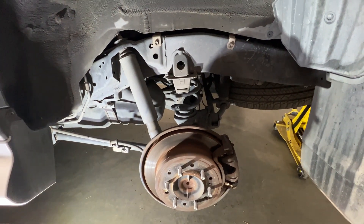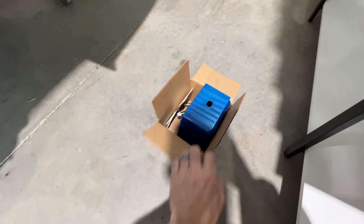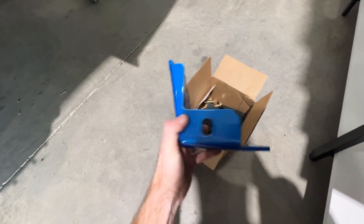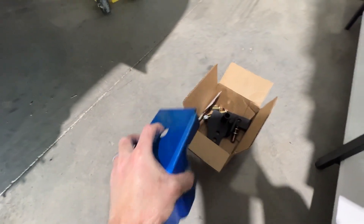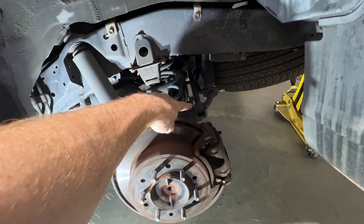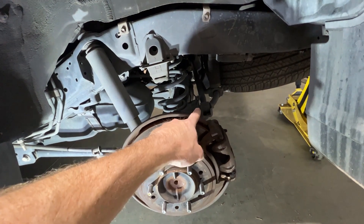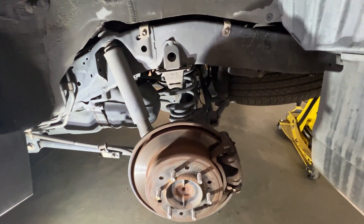We got the rear all jacked up. We're going to go ahead and get these shocks and springs out. We also have this kit from Dr. KDSS — really cool, he powder coats everything in the King blue. That's going to adjust this track bar right here up because when you lift it, it drops the axle and it keeps the geometry correct back in the rear.